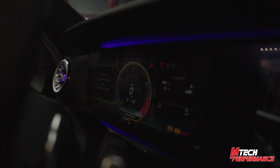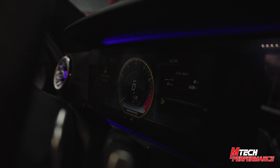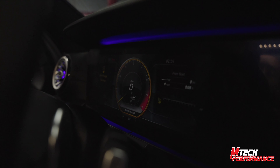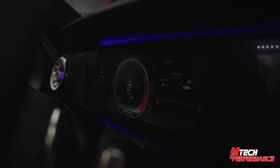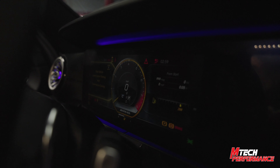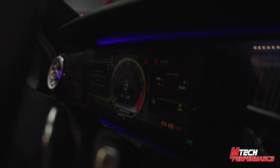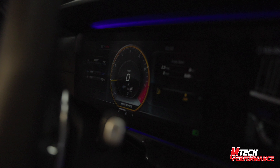We're going to go ahead and cycle the ignition — you're going to see a lot of errors in the cluster, this is normal. To cycle the ignition, turn it off, wait five seconds, then turn the ignition back on into the second click. Keep in mind this is also the click you'll need to be on when you ID the original CPC. Now that we've cycled the ignition, turn it off again and make sure the vehicle starts.